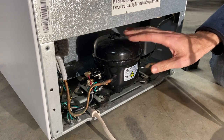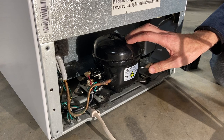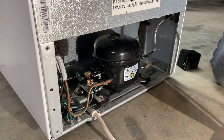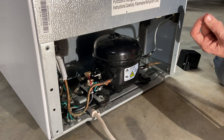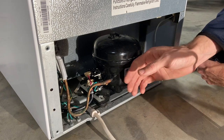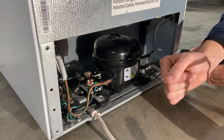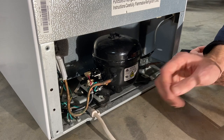Start relay on. We'll plug it in. I don't know if you can hear that, but the compressor started right up and it is currently running. I can hear refrigerant circulating. It's still running, overload hasn't kicked off, compressor started up. I'm going to let this run for a little while and we'll come back and see if it's actually cooling off inside.